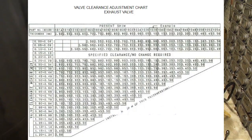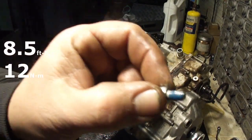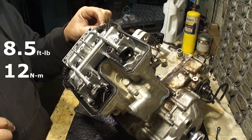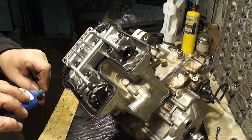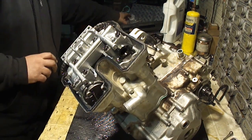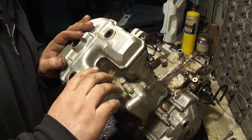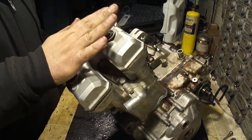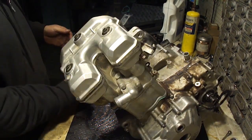This is the valve shim adjustment chart for the intake and exhaust valves — go ahead and pause this and check this out. Some blue Loctite on the cam sprocket bolts. I'm going to use my ratchet down here on the crank to hold the motor while I tighten this. Make sure you clean any oil you got on the threads, because if there's oil on the threads the Loctite won't do anything. We'll go ahead and stick the cam cover back on now. These don't go very tight — just snug them up. If you're too much on those you've got a problem.